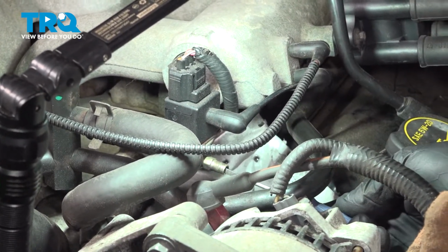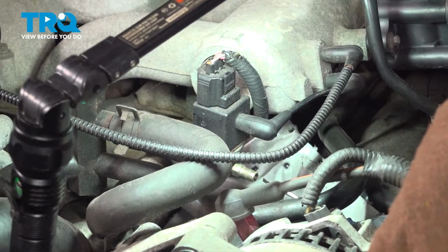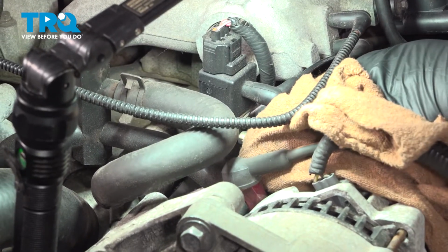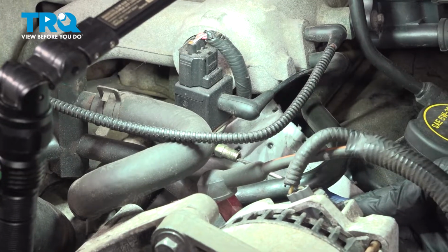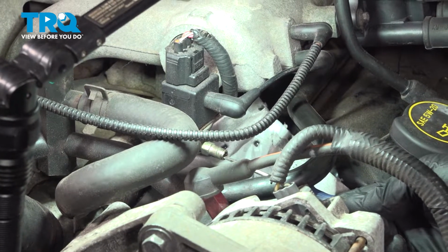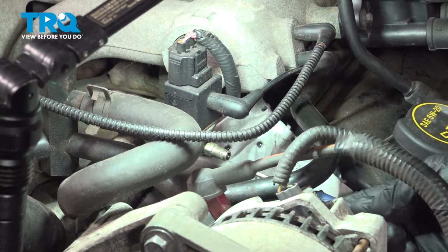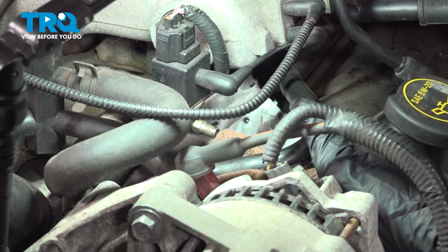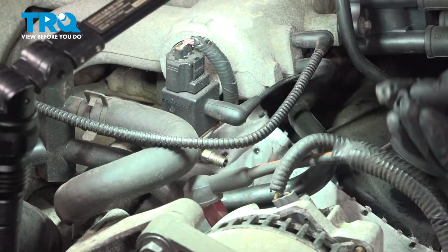You can use a small pick. You want to go inside and push on the little valve. However, make sure you're wearing safety glasses when doing this. And I like to put a rag over the top here. There we go. What I'm doing is just pushing, you can feel it spring-loaded. Gently apply some inward pressure. We do have a towel here to catch anything that would have come out, but we're actually pretty low pressure on that right now. Go ahead and install the cap.